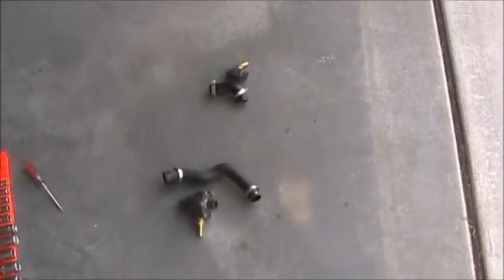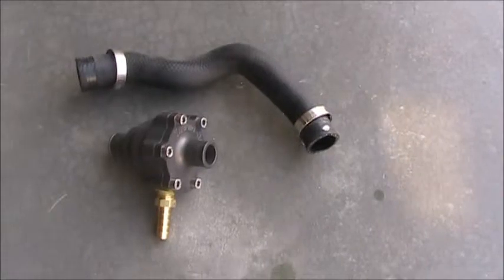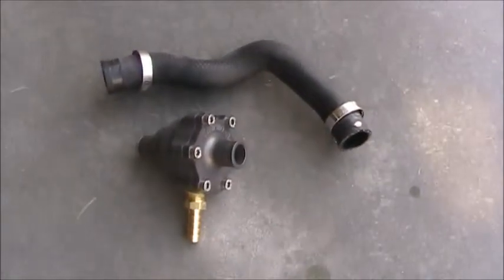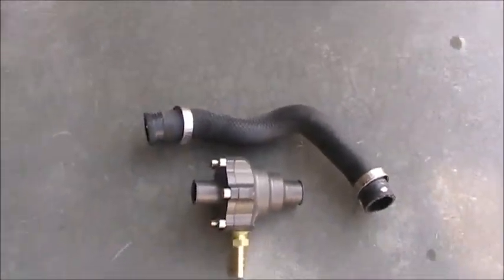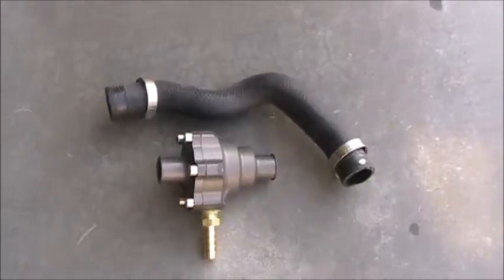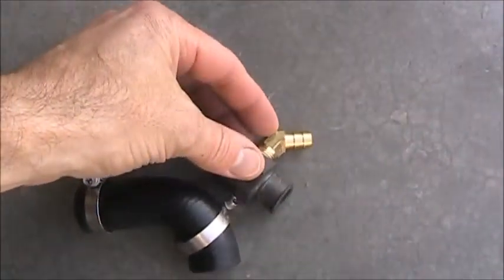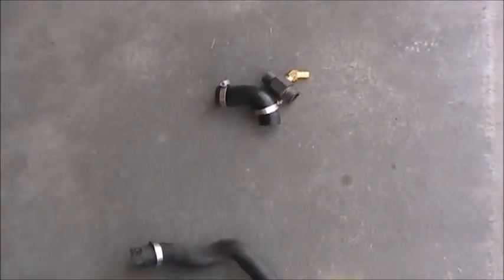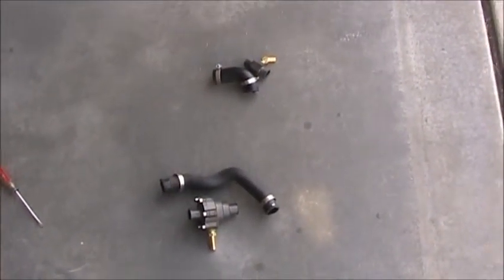At this point I've got the coolant out and I've taken off the two hoses I'll be modifying with the thermobob. There's the upper hose that comes out of the bike's original thermostat and goes into the top of the radiator — the thermobob goes in there, so from the original thermostat into the thermobob, out of the thermobob, and up to the radiator. The other hose is the return from the radiator, and the thermobob's bypass return is plumbed in somewhere in that turn. I don't have a lot of room on mine since it's already been modified for the temperature sensor feeding the fuel injection computer.